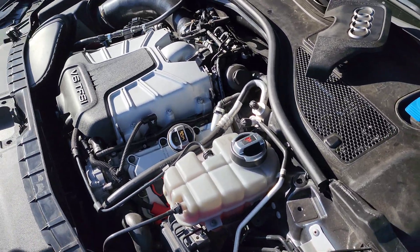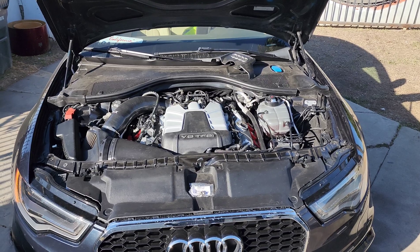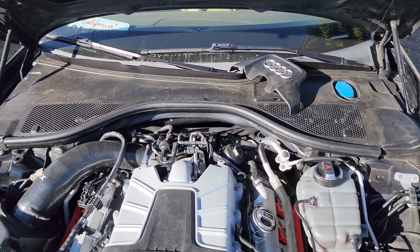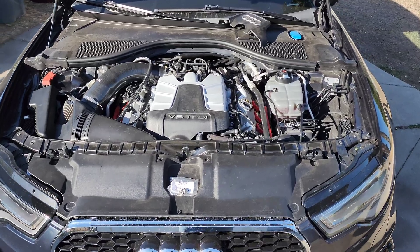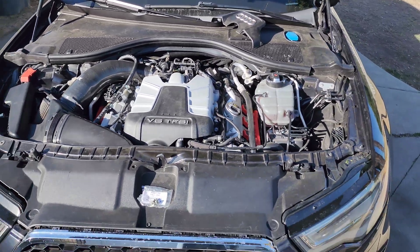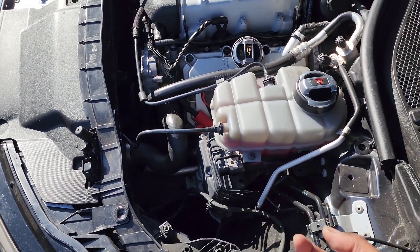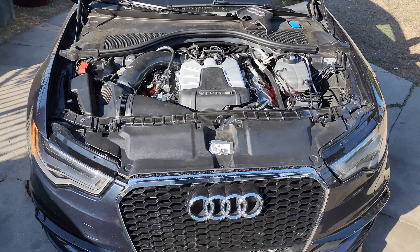I have the CWA 150 hooked up to the PWM so it's not running at 100%. When I tested the car it ran pretty cool, but there are still times coming off boost where I thought if the pump was running at higher speed it would put more coolant through the system. So I'm going to take the PWM wire off the pump and pull the pin out so it'll just be the ground and power wire, and the pump will run at 100% all the time.